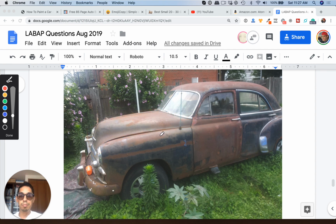Okay, now as far as doing body work and filler, you can put filler right on top of the bare metal, and feather it out and then put your epoxy primer on top of it, or you can sand it all down, epoxy prime the whole thing, right? And then scuff it with 80 grit, wherever dents you have or bodywork you need, and then do your bodywork and filler on top of it. And then flatten it out, and then you could put 2K filler primer along that section. Okay? Or 2K filler prime the whole thing.